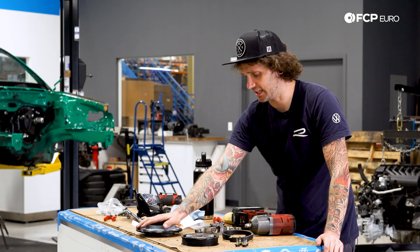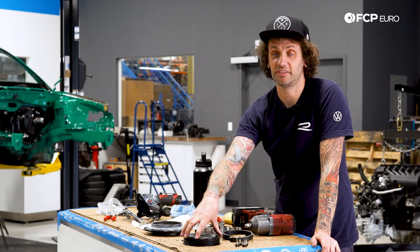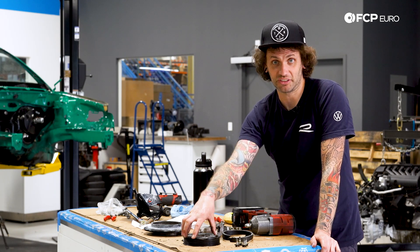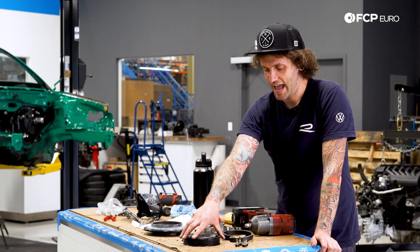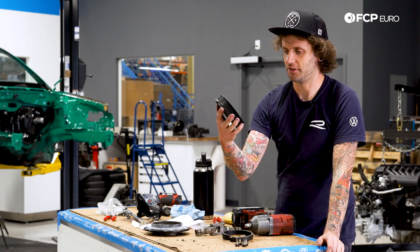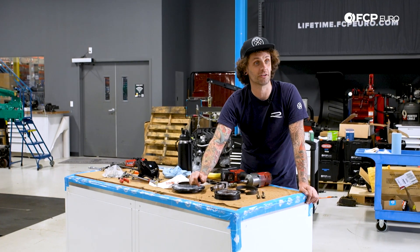The whole reason it had a harmonic damper was to reduce vibration in the drivetrain. But if it's not balanced, it'll put extra vibrations into the drivetrain, and that could potentially lead to increased bearing wear on the crank or a complete meltdown. If you're at 6,000-some RPM on the Nürburgring and your rod decides to no longer hold in place, it will come through the side of the block and go flying. So this is now being clamped down and milled flat. Is this an OEM or OEM Plus solution? Well, it's a solution. Will it work? I'm sure it will. What's the longevity? Well, this car is probably never going to drive long enough to find out.